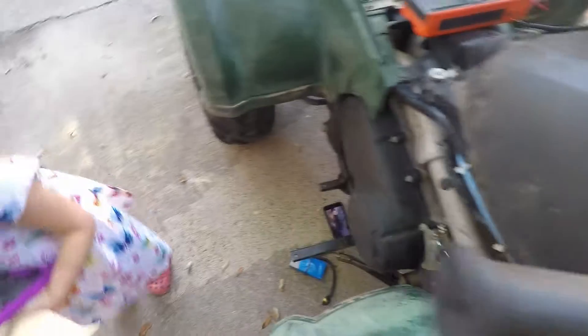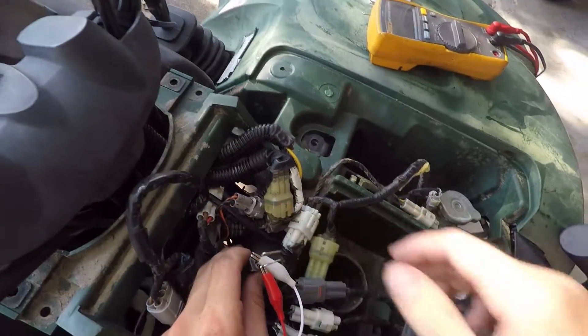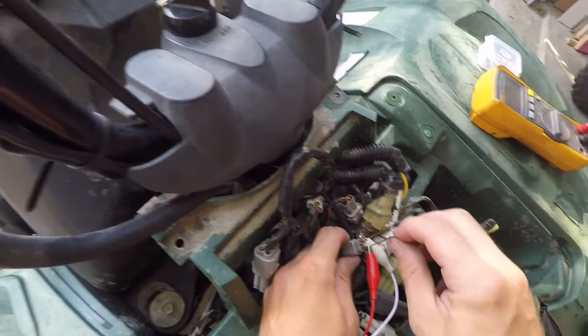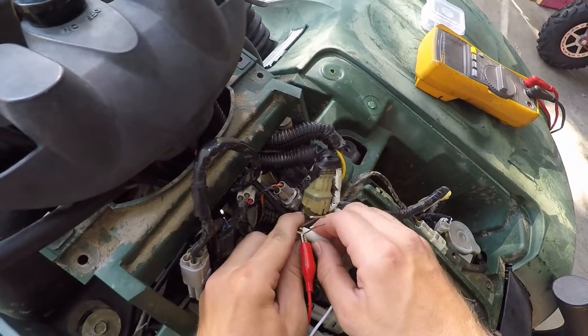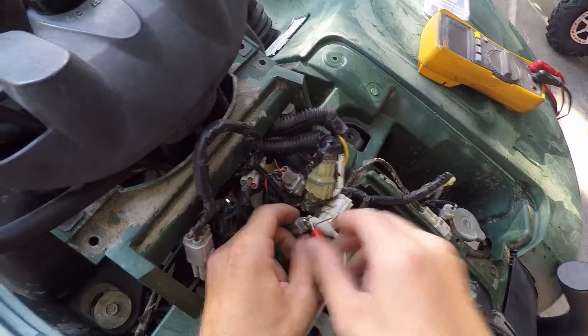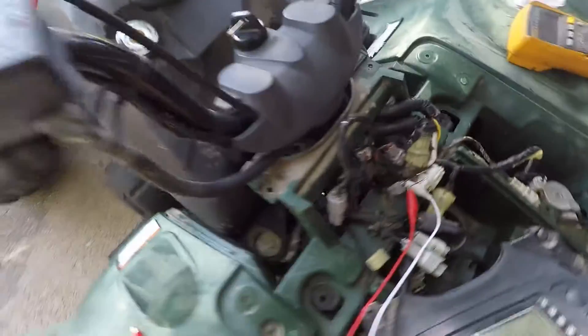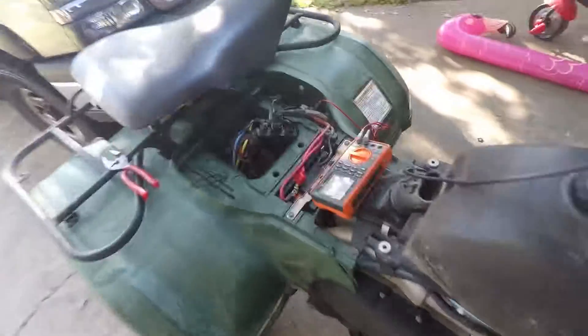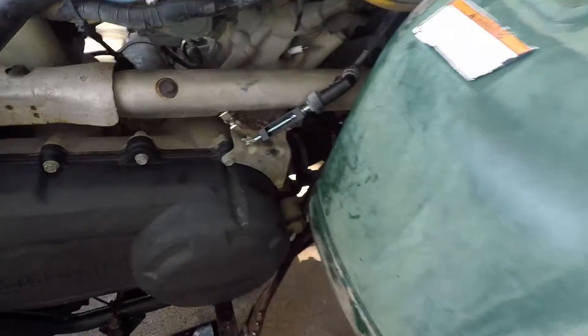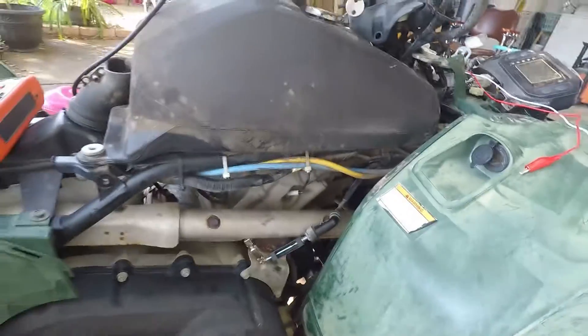What I've got here is the end of the plug that goes down to the ignition coil, and these are the two leads for it. I've just put T-pins in them and then some alligator clips to connect to them. Just make sure they're getting a good connection — we're going to emulate what an electronic controller, a CDI, does with the electronic ignition.